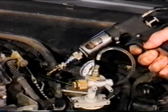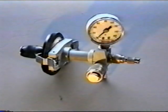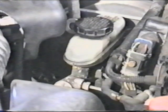The single inlet master cylinders can be pressure bled using one of Phoenix System's accessories, the Universal Cap Adapter, or UCA. We'll cover its use a little later. If the vehicle being bled falls into this category, use vacuum or RFI bleeding.